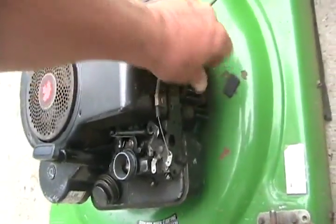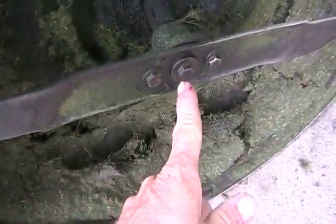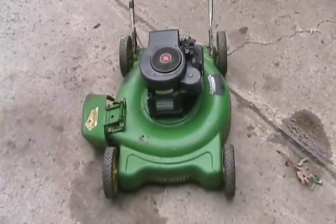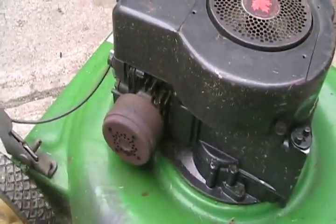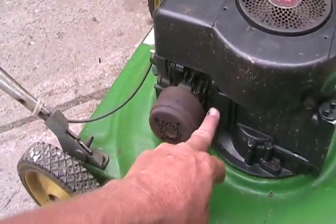Disconnect the spark plug wire and make sure it's away from the spark plug. Then tip your engine over with the exhaust side pointing upwards. Check to see that the blade isn't bent or has big gouges from hitting something, then rotate it and make sure the bolt and blade aren't wobbling. No use trying to start a lawnmower with a bent shaft. A bit of gas runs out when you do that, but that's okay — if you tip it the other way, gas runs into the motor and floods it. Also, oil builds up in the valve spring cover, pumps through the PCV system, and fills up your air cleaner, choking out your carburetor and spark plug with oil. That's why you always do it with the valve spring side pointing upwards.